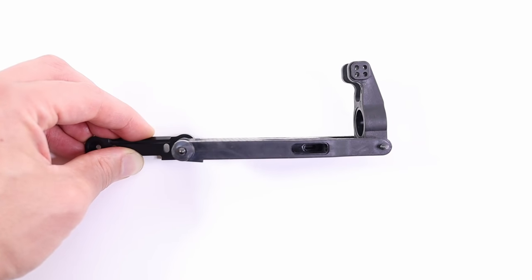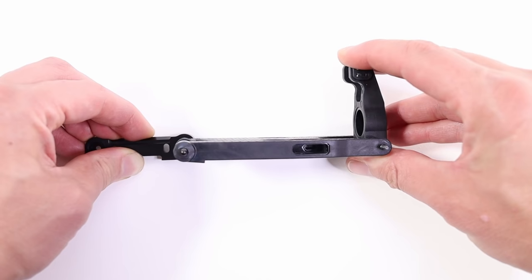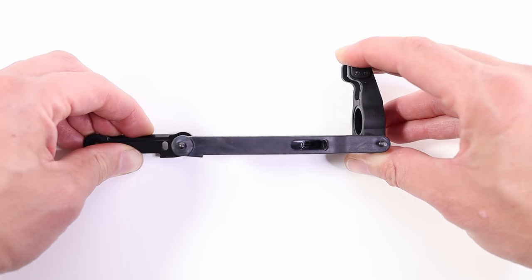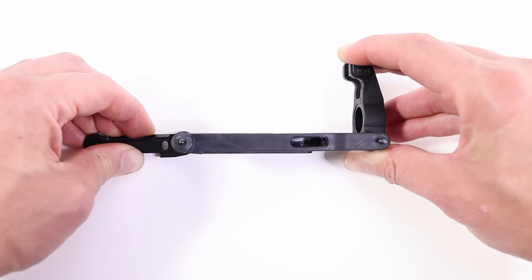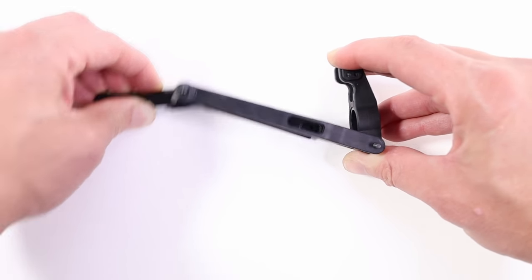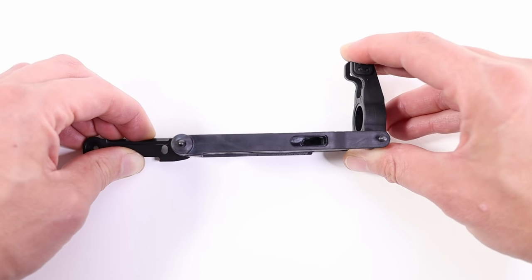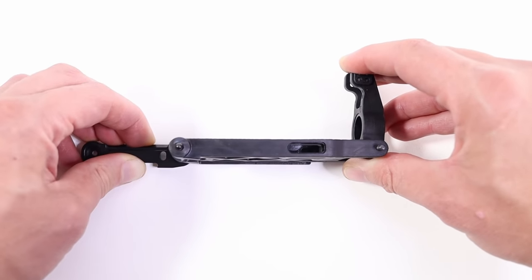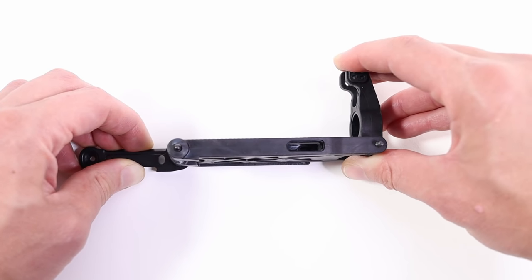The lower arm also affects jacking. So if you remember, I mentioned that the lower arm is being compressed. The tire is firmly on the ground and the chassis is pushing outwards. So we are now looking at the outside lower arm. So I'll hold on to the hub as if the tire is now gripping the ground. Then I'm going to push on the arm using this arm holder. When the arm is perfectly horizontal and I push, nothing happens. If the inner pivot is higher than the outer pivot and I push, it raises the chassis. If the inner pivot is lower than the outer pivot and I push, it lowers the chassis. The lower arm position has a major effect on the direction of the jacking force.